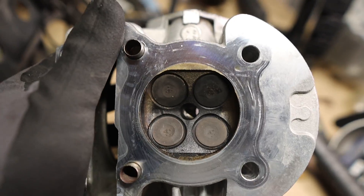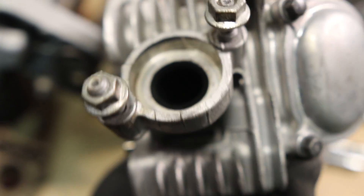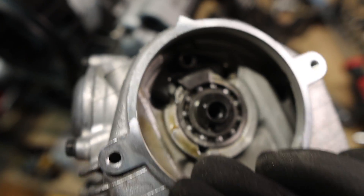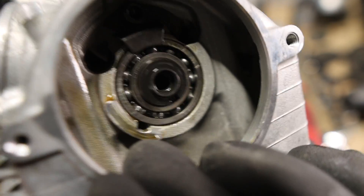There's your chain tensioner guide on the bottom, which I'll need to use again. Look at this four-valve head — it is huge and heavy as crap. That's my exhaust, and it looks like it's definitely ported out wider. The cover has the valves. In this build, it comes with a new, more aggressive cam, so this is going to be more complicated because I don't know how in the world I'm going to get that cam out and put everything back together. Time to read some instructions. But before we're done today, we're going to take the piston off.